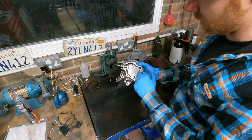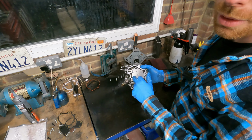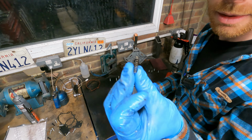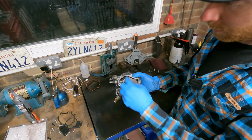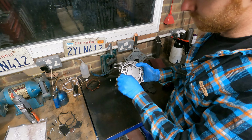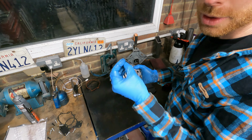But if you do go in there, these bolts are very tight and they can round off. Again, Torx bits. And then once you get in there, in the kit, you get these little springs. They've got a ball bearing on the end of them following a cam, which produces your fuel pressure. So when you take that off, be careful not to lose these springs or the ball bearings, because that'll write that off. Not what you want to happen.